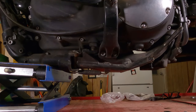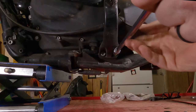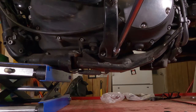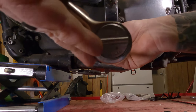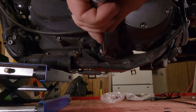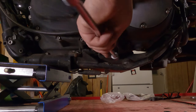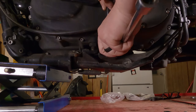Now for stator removal. To remove the left side foot peg mount, you have two Allen screws here — they each take a 5/16ths Allen wrench. I have an Allen socket in place of an Allen wrench; it's just a lot handier and a lot stronger. Lefty-loosey that one free, then pop over to the other side and lefty-loosey that one free. Full disclosure: I broke both these bolts free before I hit record — saves a lot of grief. Hold your foot peg up a little bit, lefty-loosey that bolt all the way out, then lefty-loosey the other one all the way out.